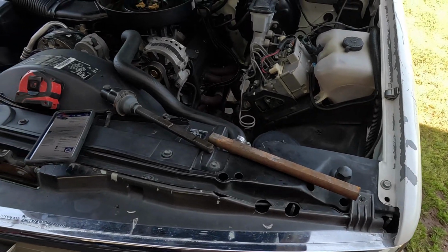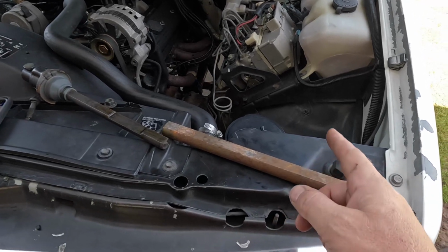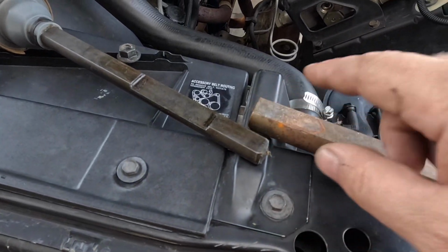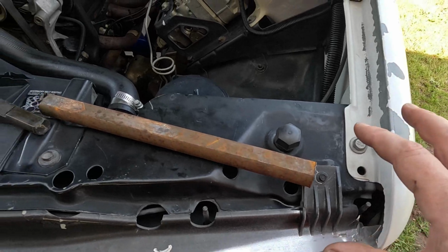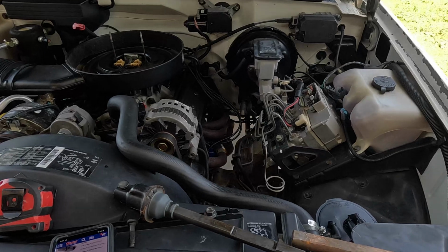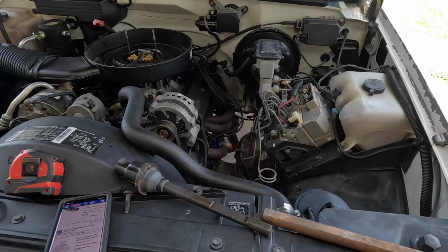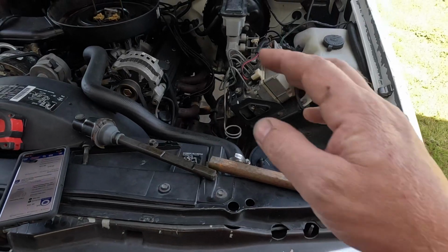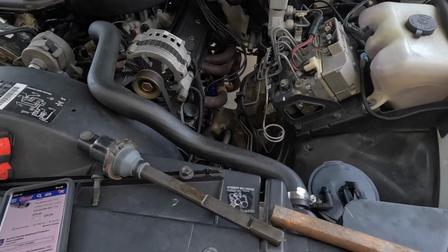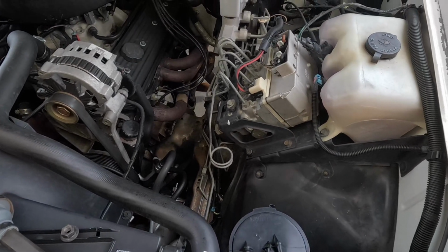And I actually get to save a few more bucks than that because I don't need to purchase an extra 1 inch double D shaft. I have some left over from when I did the pickup. So this will slide right into this, and my upper U-joint will slide on there. And then it'll be nice and solid for way cheaper than the 250 bucks for that whole replacement. I got lucky here. I guess there's some Jeep steering shafts too, maybe. I don't know that. I haven't looked up any videos, but try that option too if you want to hunt around looking for one with low miles.